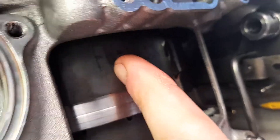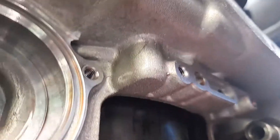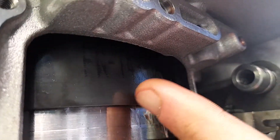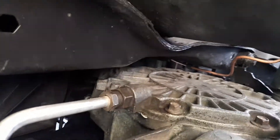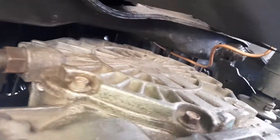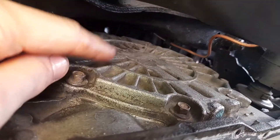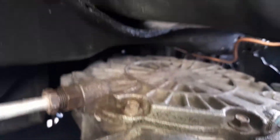This is your brake band — this piston either engages or disengages it for second, third, and fourth. If the piston's not engaging, that's not going to engage and you're going to lose second or fourth. This actually looks quite good — I've looked at it more closely and there's not as much wear as I thought. In fact the brake band looks as if it's got a lot of life left in it. The gears are quite okay. This is the side plate — you've got the return line here that you might have to take off if you wanted to get it off. You have to drop the gearbox a little by taking the top mount off, drop it down, and then you can get all these bolts. This is actually a weakness on the Mazda gearbox — apparently there's a bush going through into this reverse drum bearing that can wear on Mazda models, but the Ford models don't seem to have that problem.